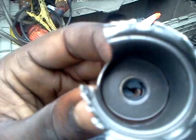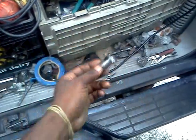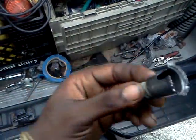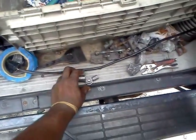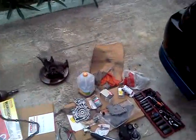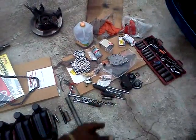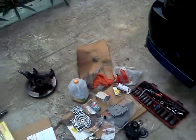I'm assuming that's what the problem was — this was probably getting wet, getting the plug and sensor all wet. Basically I replaced this, but they say whenever you have to open the side of the transmission to replace this, you should also replace the one-to-two shift, three-to-four shift, the TCC itself, and the pressure switch — and that's what I'm about to attempt to do.